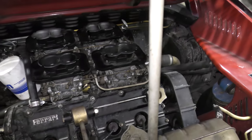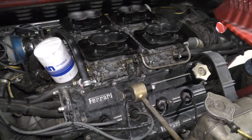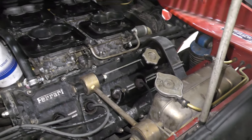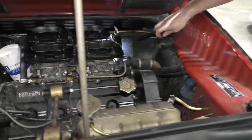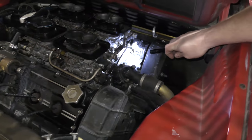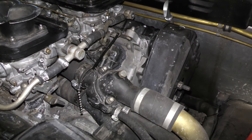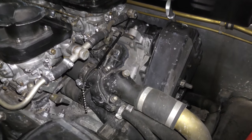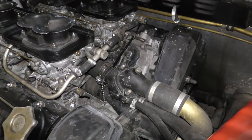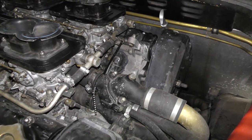One of the things I noticed during filming of Car Trek is they had some coolant leaks on the intake manifolds. You can see over here that they just sandwiched some silicone in it to stop the leak so they could continue filming. I don't blame them for doing that - they couldn't just stop filming. I will have to take those all off, put new gaskets, and do it correctly. But at the price I got it, I can't complain.